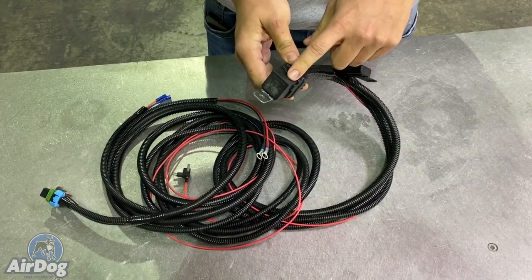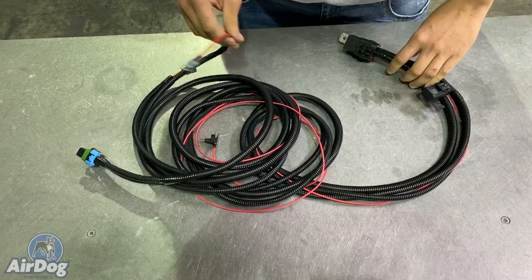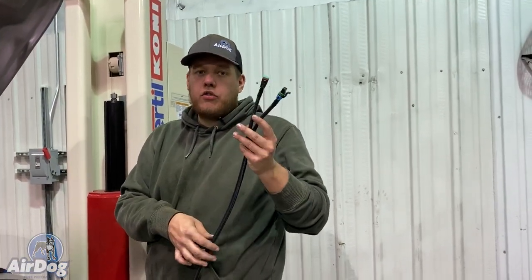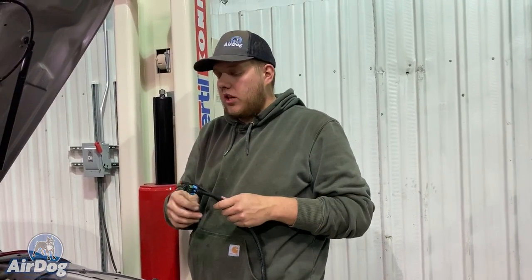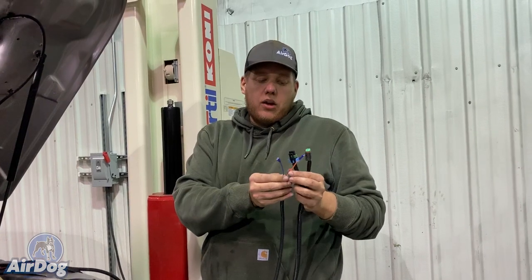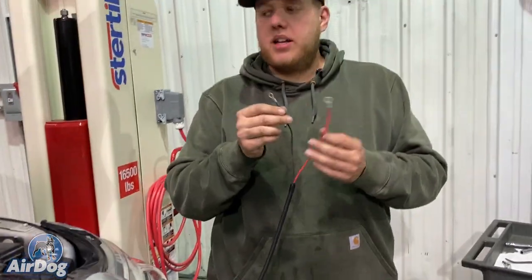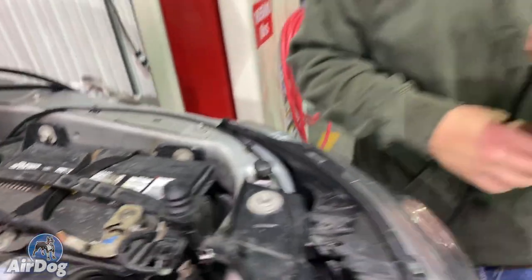The first step for wiring is to mount your AirDog relay. We ask that you mount it on the firewall or anywhere close to the battery connections, as you will be hooking to the positive and negative battery terminals as well as the connection at the AirDog itself. Now that the relay is mounted, we're going to get the harness dropped down to the underside of the truck. This connector here is only going to be used for the fuel pressure warning light — that's a kit purchased separately, so if you're not using it, just tie this up out of the way. You'll also have some blue and orange wires — put those up out of the way, but do know if these somehow touch, they will pop the fuse, so tape these up. Hook the positive and negative to the battery — on these Fords they have nice terminals to go directly to.